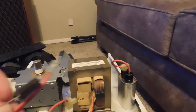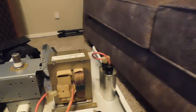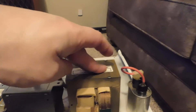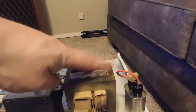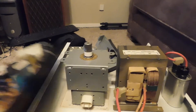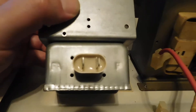This is the microwave oven transformer, and this is the diode that forms a voltage doubler circuit. You've got two terminals here which provide filament power, and then you've got the primary and secondary windings. The whole metal shell — this iron core of the transformer — is the return for the secondary circuit.